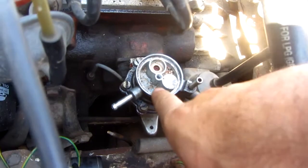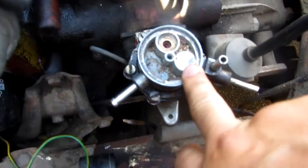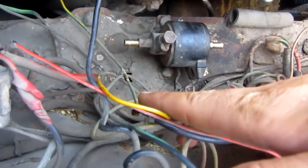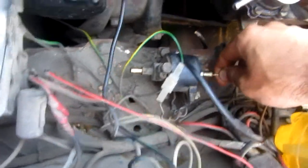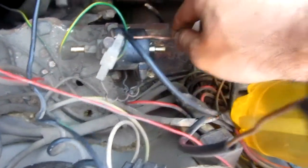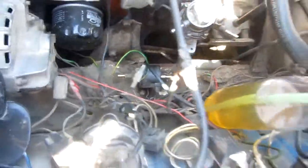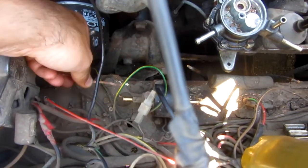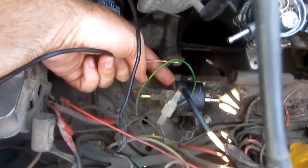This is the fuel pump of the car — it was too dirty inside and wasn't pumping properly. It is dirty but I think it's pumping the fuel. This is the shut-off valve for the gasoline and it was not working properly. I got a wire and stick it in, and from the other side it enters here, so somewhere on this line the fuel is blocked.